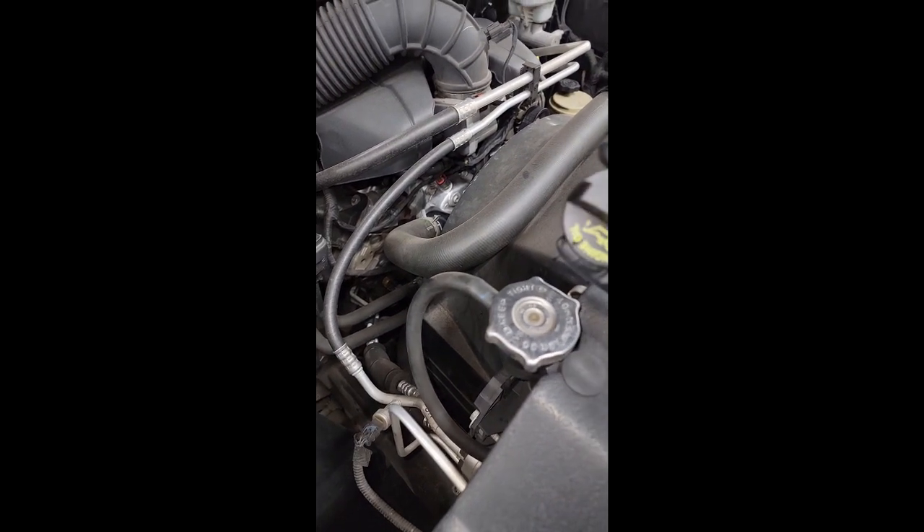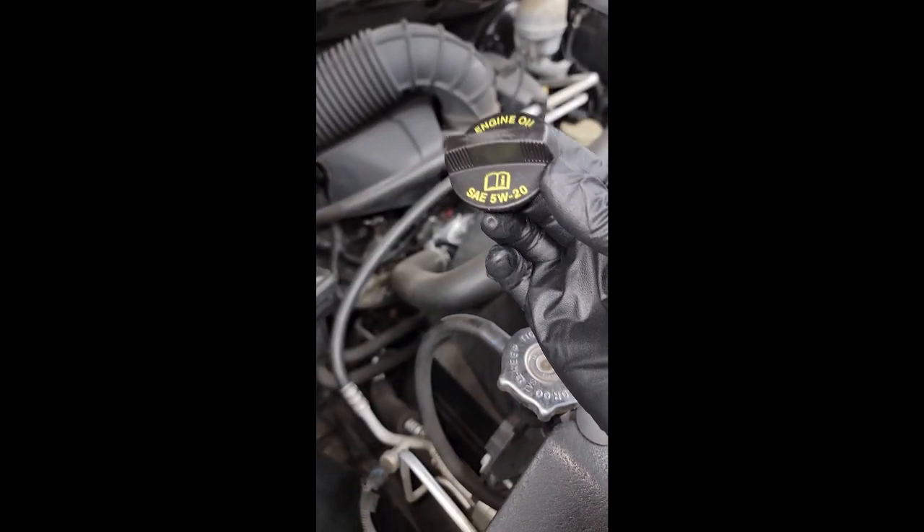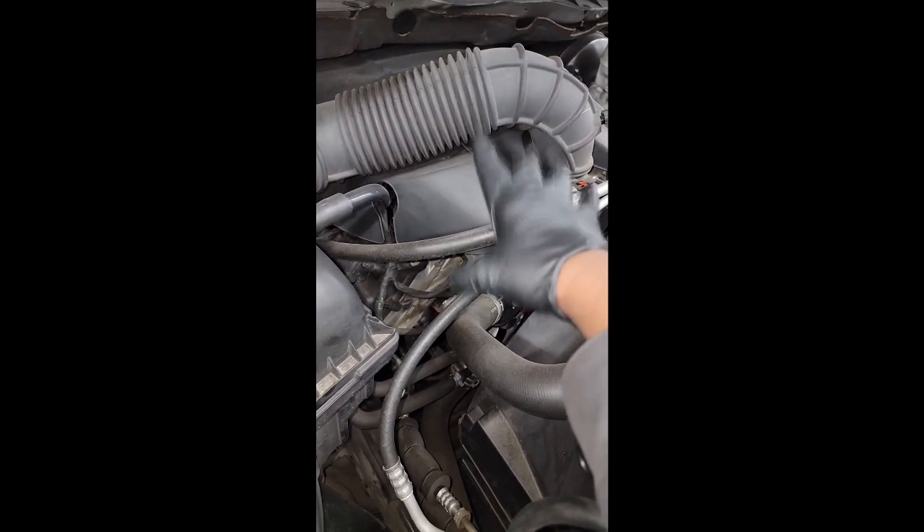As far as the oil weight viscosity, please try to stick with 5W-20. I'm not sure why you guys fight with the engineers. Remember, this engine uses four MDS solenoids, so that specific weight of oil is crucial.